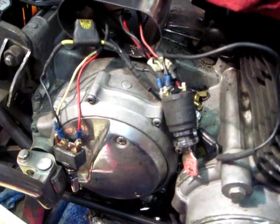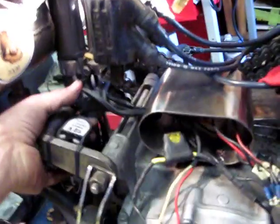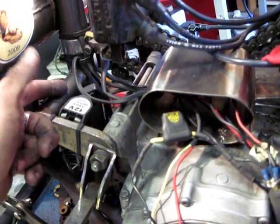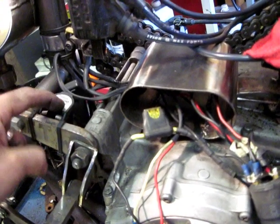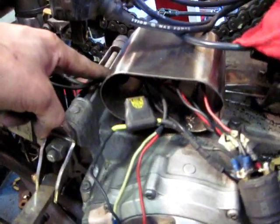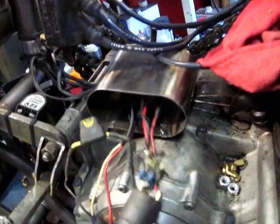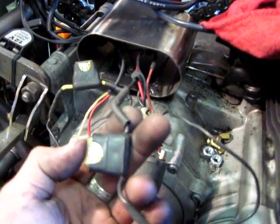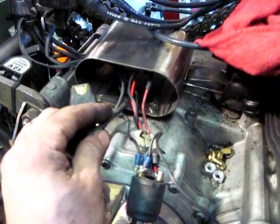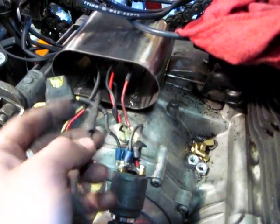This is what I've got going on inside the oval electric box. My main 30-amp fuse is right back here so it's accessible. Here's my cell phone charger — I get those at Walmart; they're made to go in the back of a truck bed. You get one wire that goes down to the negative on the battery, one that goes to ignition — that comes in through the grommet in the back and is connected to an inline fuse right here. I use bus fuses, the little horseshoe ones, so I can get them at any gas station if I ever need a fuse. I have a quick connector right here — it's the only quick connector on the whole bike — so if I ever have to take the electric box off, it's just covered in shrink wrap and I can disconnect that and take it off.